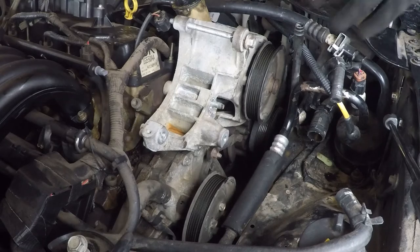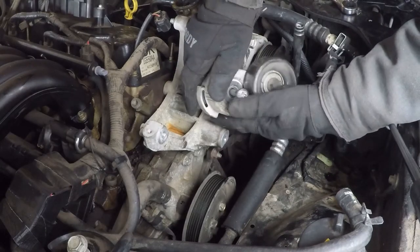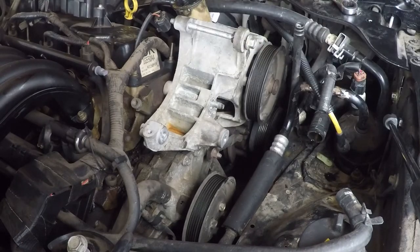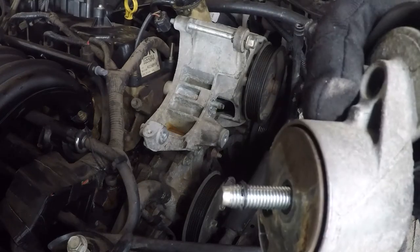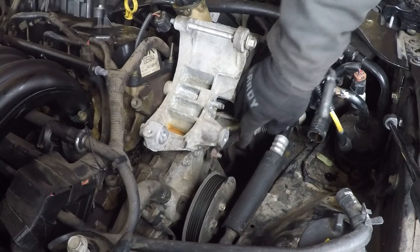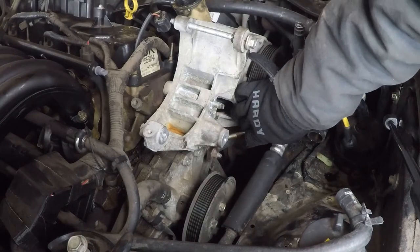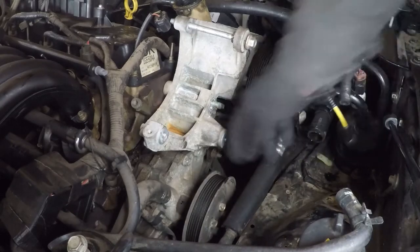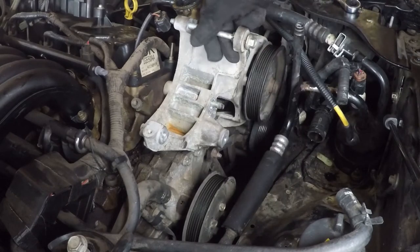I did take this guy out. This guy's a big old T50 Torx. I had to get a new bit. Mine was buggered up and had to get a new one, and gosh darn, that made all the difference. Though it was frozen on there pretty hard, even though there's clearly no rust. Then once you get that out, there's a bolt underneath it that you can pull out, 15 millimeter bolt. That goes right in here. And once you get that out, you can get this slide.